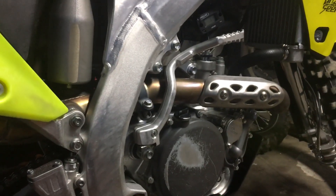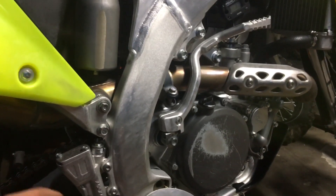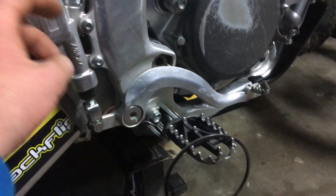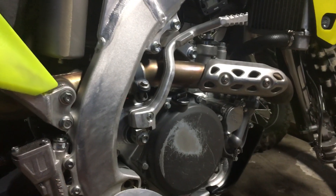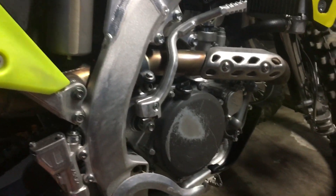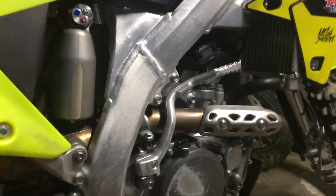I have seen in a few reviews where they're saying clutches have gone up as early as 15 hours. I suspect it all comes down to these two rings, which might be causing the clutch plates to, when they get down to a certain point of wear, just interfere a bit with the whole clutch system. That's what I suspect - and that's the only way it really could be affecting things. But that's the way to do it: just remove them and you'll be ready to go again.